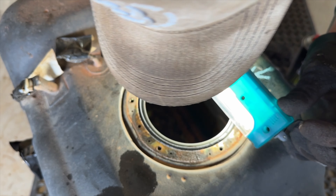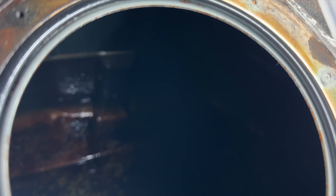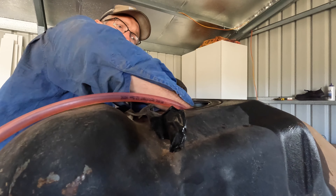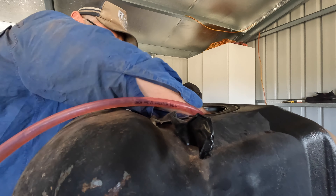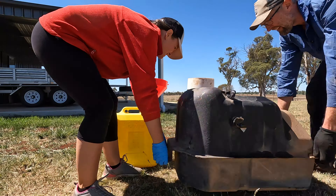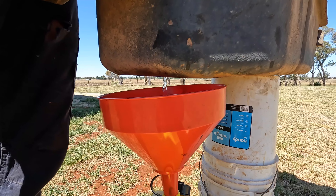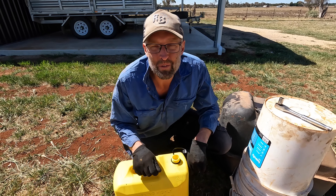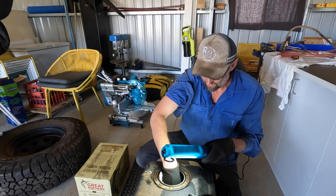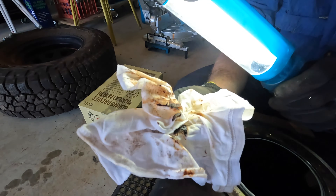It looks like for both side walls there's hardly any rust, but the bottom — the bottom looks like there's a fair bit of rust on it. That's a problem. We've drained almost 20 litres out of that sub tank and looking down in here I can see small particles of rust. Maybe we've found the cause of the problem. There is so much rust in here. Now we've drained the tank I'm going to get a fresh rag and give it a wipe and see what comes out. Don't think the bottom of your diesel tank should look like that.